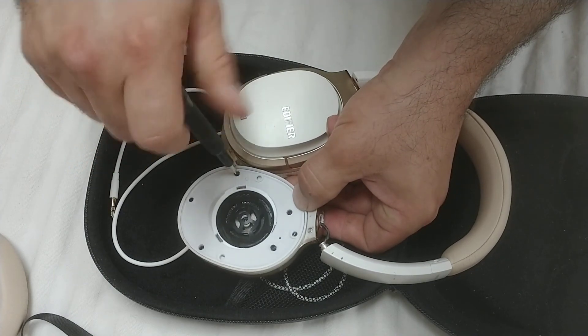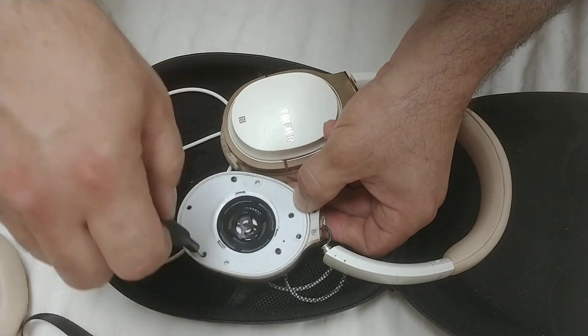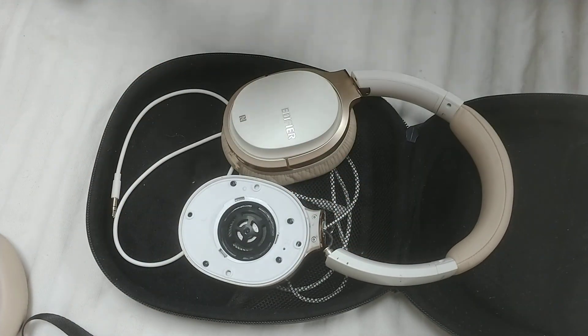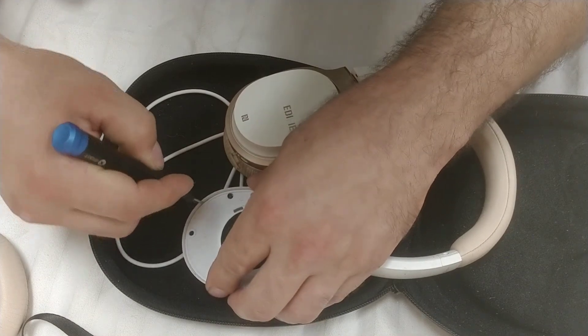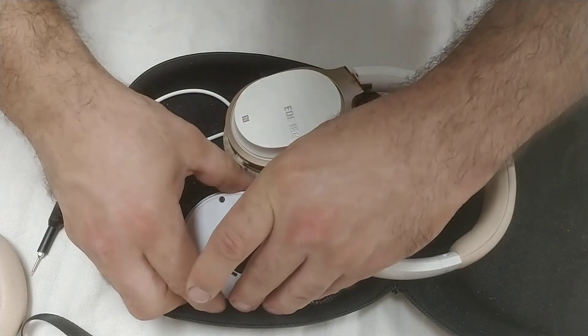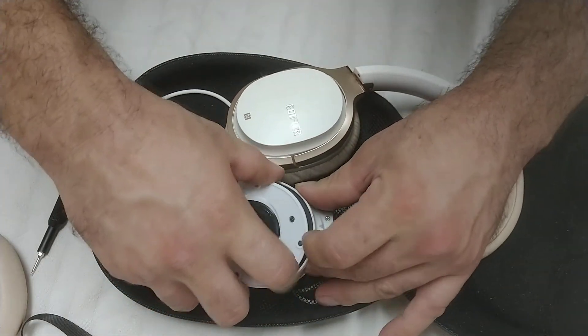You do not actually have to go this way. I find that it is slightly easier and gives you a little bit more space if you do it this way though. Those four screws should be out of the way. Pry up again gently with some type of spudger, because there is a microphone wire and speaker wires — or maybe just speaker wires on this side.